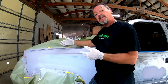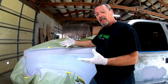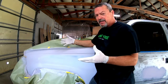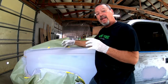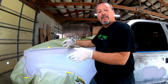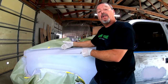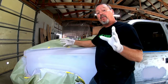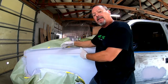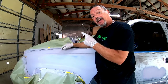The one drawback is it is a little pricey — the kit is around $180 for a gallon of primer, which would do your entire vehicle, so it's not terribly expensive. I think it will save you time in the long run because you won't have to apply an epoxy primer and then a 2K primer over top of it. It's all one step and you can go over body filler. I do like this primer and I think it would be good for certain repairs. It would be a really good primer if you're painting your entire vehicle.